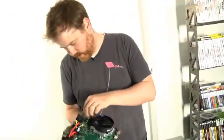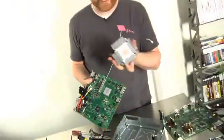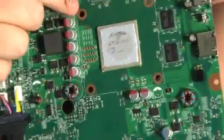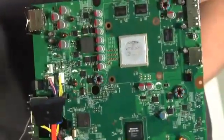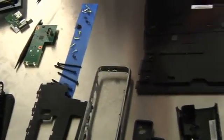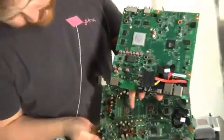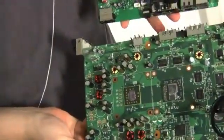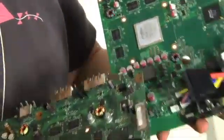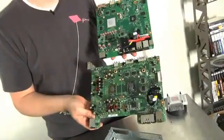For the big reveal — I'm going to disconnect the CPU fan. This is the new Xbox 360 CPU. You can see a copper core CPU cooler, just like in a modern PC. The CPU and GPU combination is underneath this one heat sink. This gray stuff is thermal compound — something you use between a CPU and a cooler to even out any dips or divots in the surface, even microscopic ones. To compare: on the old Falcon board you can see the GPU here and the CPU here, with all these high-speed interconnect lines between them. The Valhalla design puts both chips under one heat sink, so it doesn't need that — they're connected on the die. It's a much simpler board, a little bit cheaper to produce, and hopefully less likely to fail.